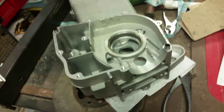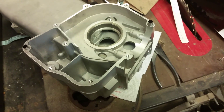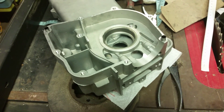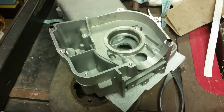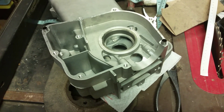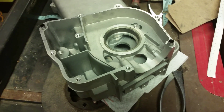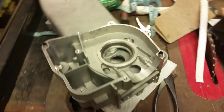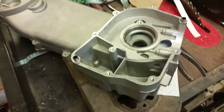So they start out at 63 millimeters stock and you can bore them up to 65.8 millimeters — that's how you bore out a GY6 engine. If you want to discuss anything, you can reach me in the YouTube comments or more easily at my web forum at dansgaragetalk.com. If you're interested in having these services performed on your engine, look me up at martinmopeds.com — we offer everything from engine replacement to case boring and building performance race engines.